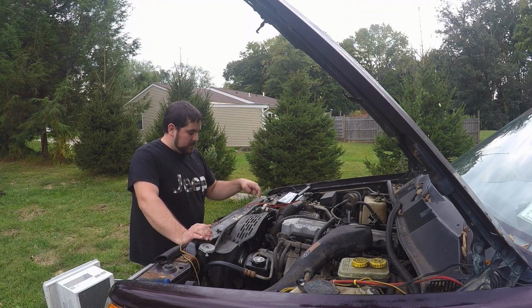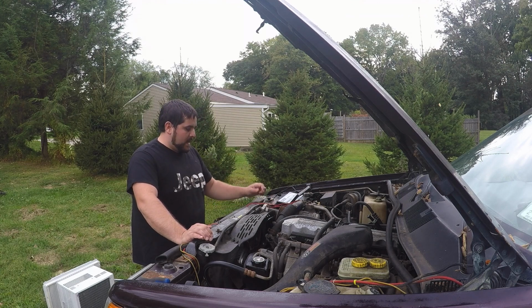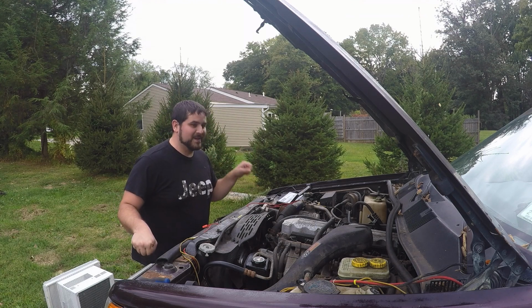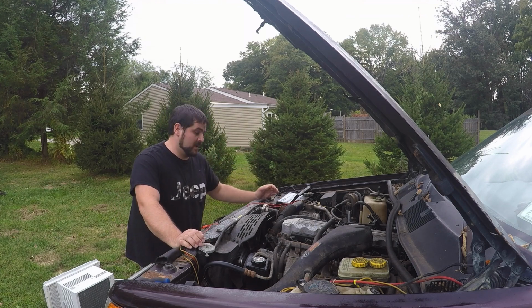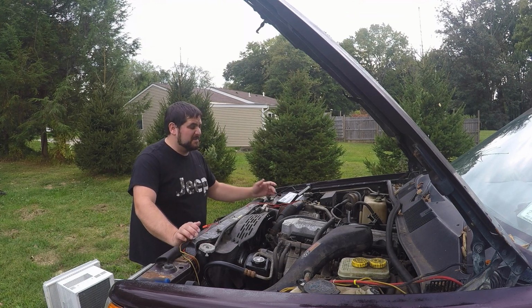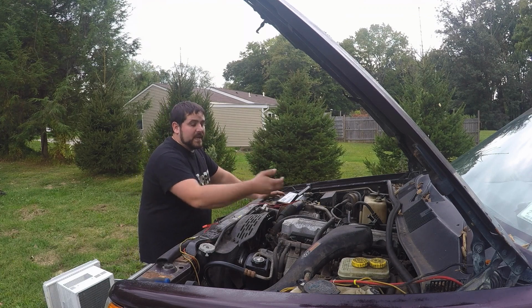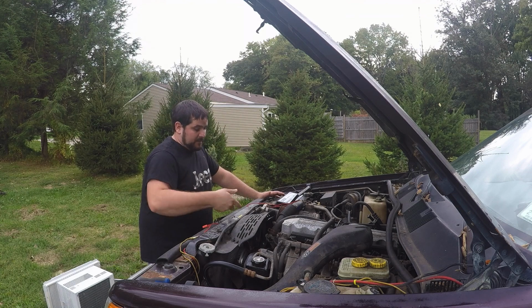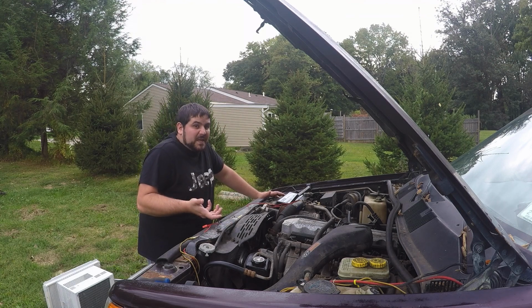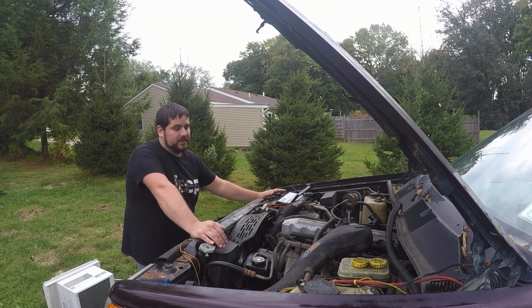When the new one showed up, it was actually the towing version, which we'll get to in a second. I lifted the two up next to each other, side by side, and the old one was at least 5 pounds heavier. I'm assuming that's built up sludge and junk inside from the coolant. When I first did the head gasket, I flushed the block, and then I flushed the radiator till it was clean, but I guess there was still stuff built up I couldn't get out. So I ended up replacing the radiator, and that actually did solve my cooling problems.